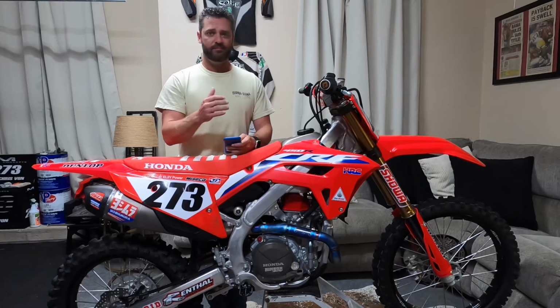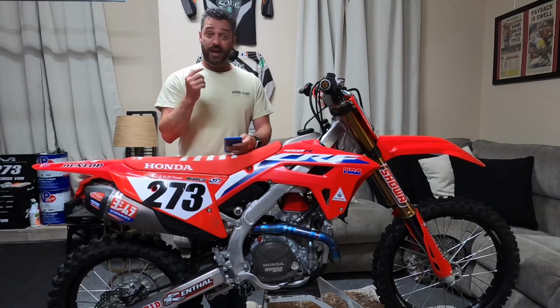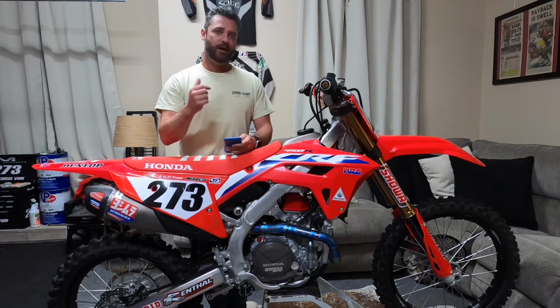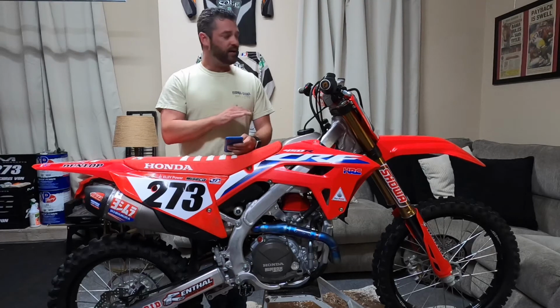Okay, on the compression, standard compression, 181 pounds, I'm at 8 clicks. Rebound, I'm at 11. And oil height right now, I have it at standard level.